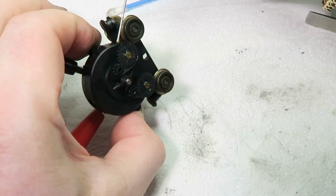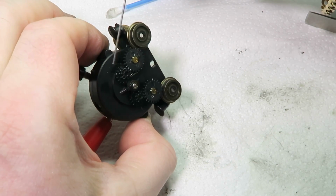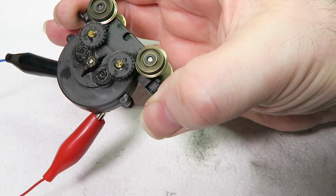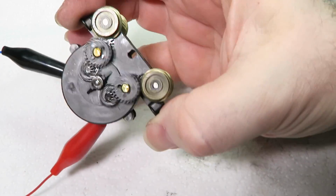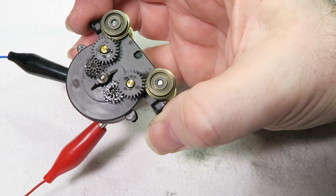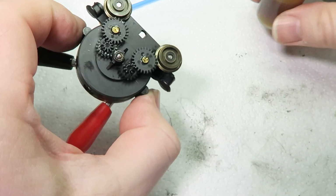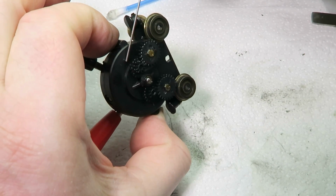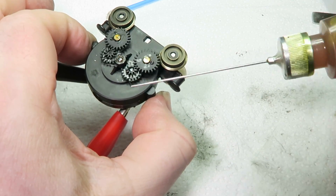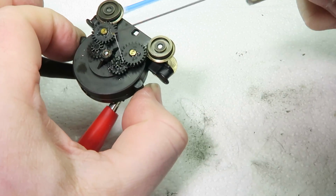Now initially, whilst it settles in, you'll hear the motor will run slightly slower. It's getting used to it. So as you see, she slowed down a little bit. That will change. Now we just changed direction. When the webbing goes, the grease is nicely spread on all the teeth. Pay good attention to the outside cogs of these here, because they run onto the armature. That's a big old drive cog, so that could do with a little bit of extra lubrication. The rest of them you don't need too much really, just enough.